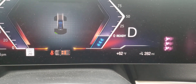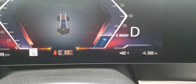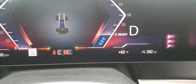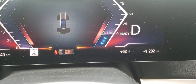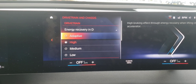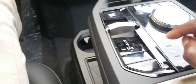High gives you three lit-up blue lines, Medium gives two, and Low gives one. At Low, the car will roll a lot more. At High, as soon as you let go of the throttle the car slows down considerably — basically one-pedal drive. But in this car you also have Adaptive, which knows your geography, whether you're in mountains or hills, and adjusts recuperation for efficiency. And there we go — Adaptive, and we're in regular Drive.